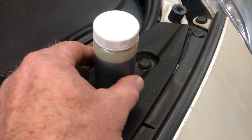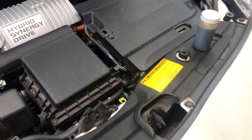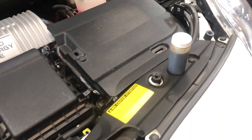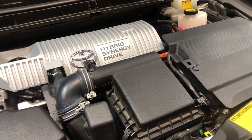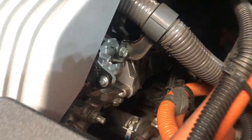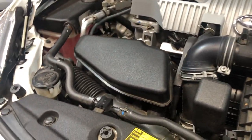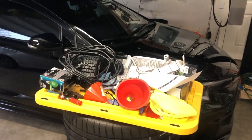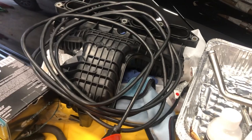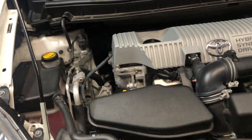I've got the oil refilled and caps back on. Here's my sample of oil to send into Blackstone. I've never sent a sample in on the Prius, so at 155,000 miles I figured let's send one in. I don't expect any surprises because the coolant level doesn't change, the oil has looked good coming out, and I change it every 5,000 miles. I also keep the EGR cooler, EGR valve, and intake cleaned out — I have the new clean parts right over there ready to swap in. The oil change is done, good for another 5,000 miles.